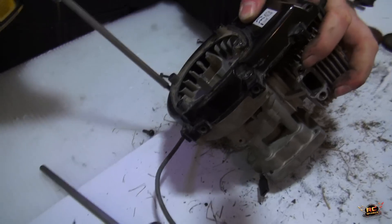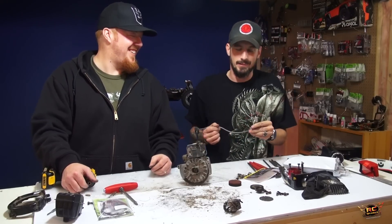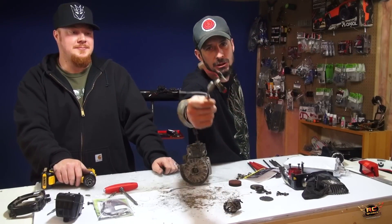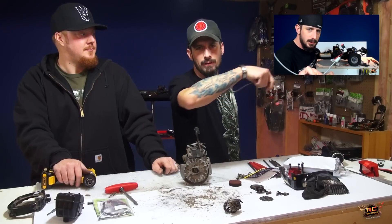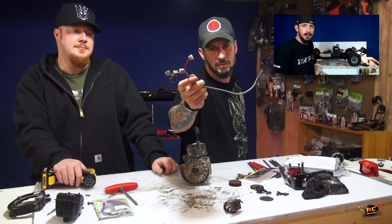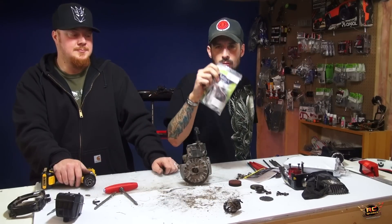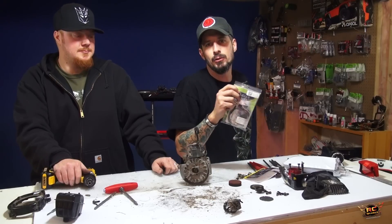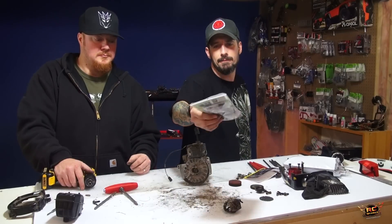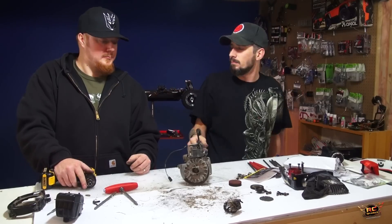Let's continue taking off the fan cover and we'll have most of the motor exposed. Look at that — Killer RC switch. I did a video on that. This is an important safety feature if you're running a fifth scale. A responsible RC-ist, in my opinion, runs a cutoff switch. The cutoff switch is designed to run with the radio and transmitter — when it loses a signal it kills the engine. Killer RC kill switch — great if you want one, your own loss if you don't.